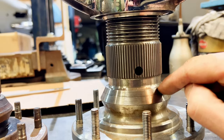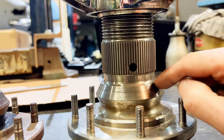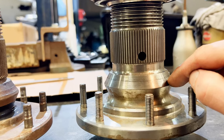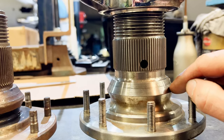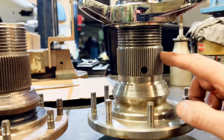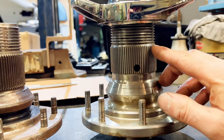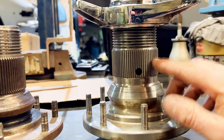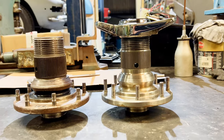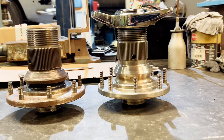And then these, they won't be doing that much work at all. These are more if, you know, if it came loose. I mean, you'd struggle to rely just on the taper, I think, because of the shear that you've got, particularly on the rear wheels, because you imagine you've got all the torque of the drive through the rear wheels and then the braking, whereas the front are only really under strain under braking, aren't they? That's the only time you've got strain on this whole unit, really, of that nature. Obviously on cornering, but I'm talking about the sort of shear loads on these, which you'll own on the back, obviously under acceleration and braking. On the front, only under braking. So that's it. That's why we're doing it. You know enough about them now, don't you?